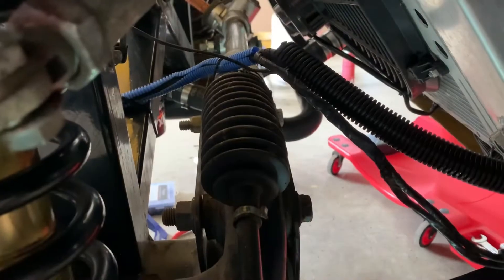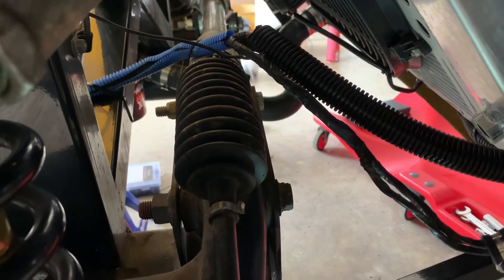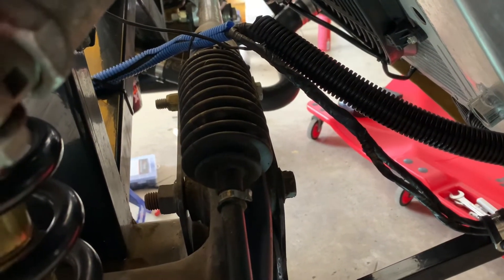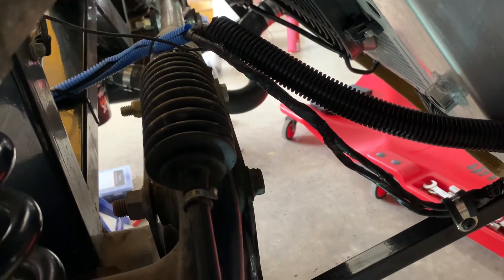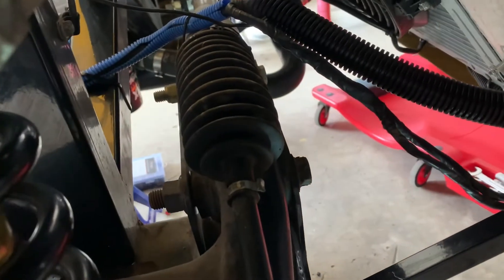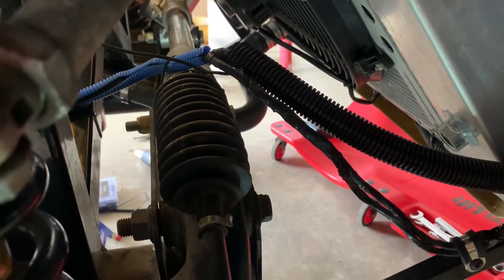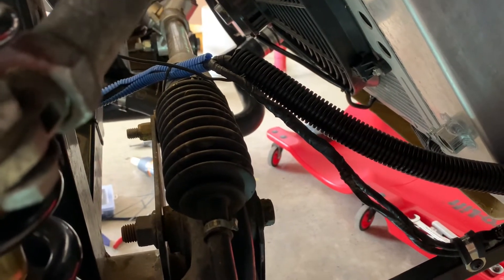Back to buttoning up a few issues. One thing I wanted to bring up is this wire here — I noticed it yesterday when working on the passenger side. For some reason when this thing was built, they put it up and over the steering rack, just resting on the bellows. What I did for now is zip tied it behind the bellows and also on the X-member just to keep it away. That's the wire going to the alternator. I'll probably eventually disconnect the tie rod end, wrap it around the tie rod, tuck it underneath the bellows, and mount it to the frame with a cushion clip. For right now though, I just want to get the thing running on the road.